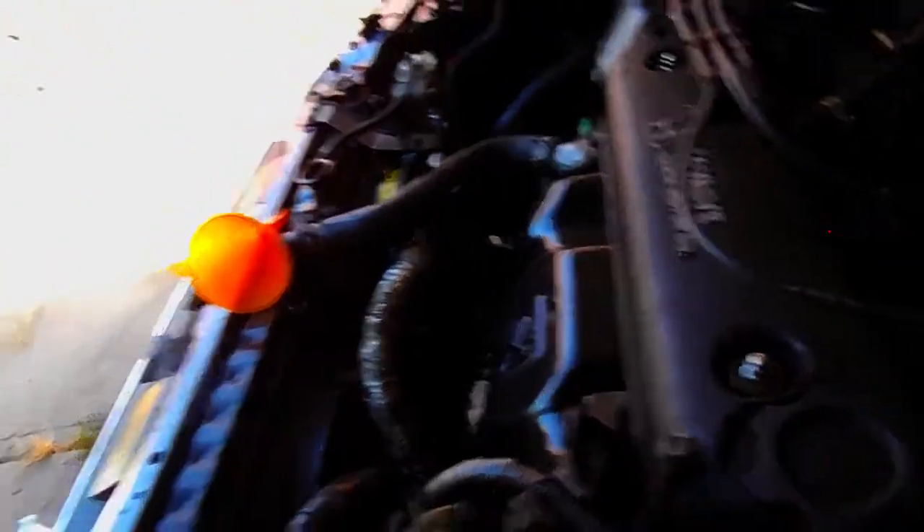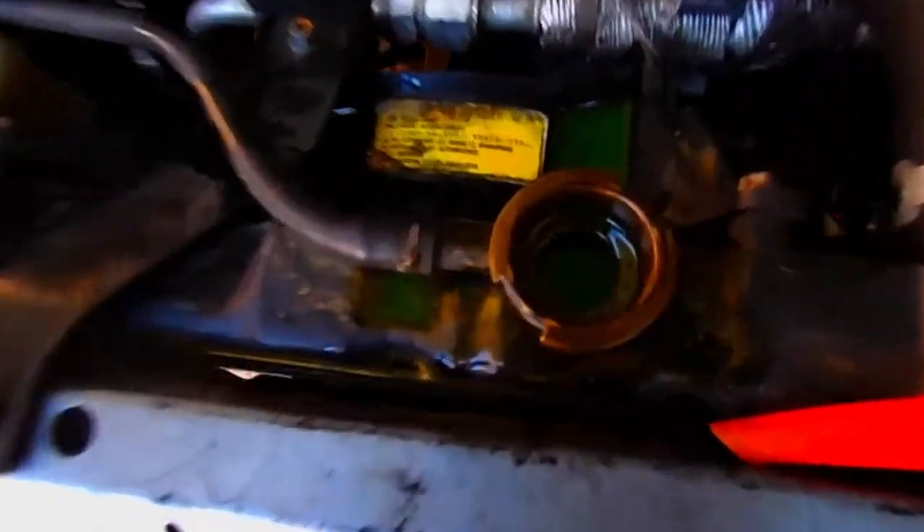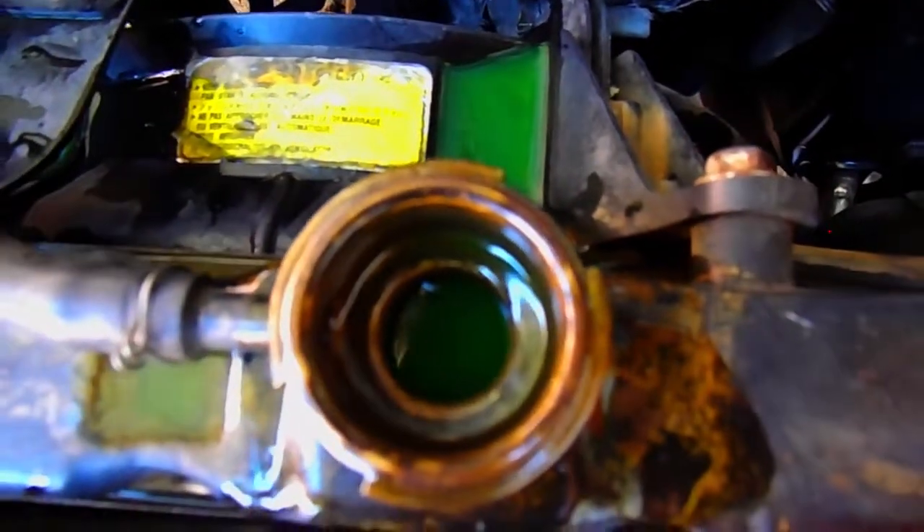It's pretty close to medium right now, so it's very interesting where it goes. The fans don't work, remember. What I'm not seeing is the water pump at work right now. You're supposed to see some flow through the radiator — the water pump working itself. So we've got nothing yet.